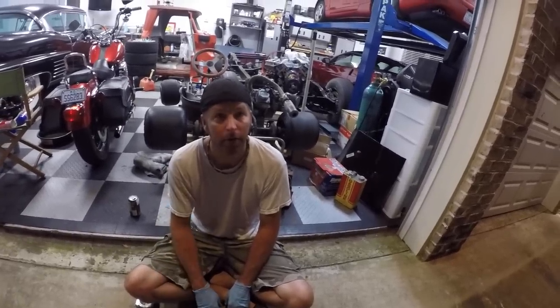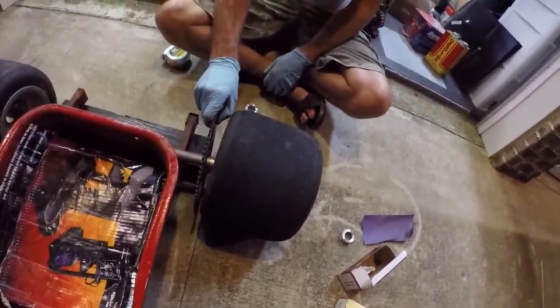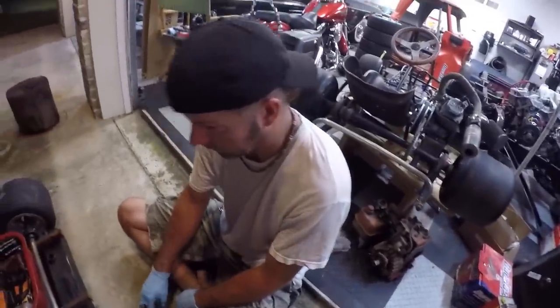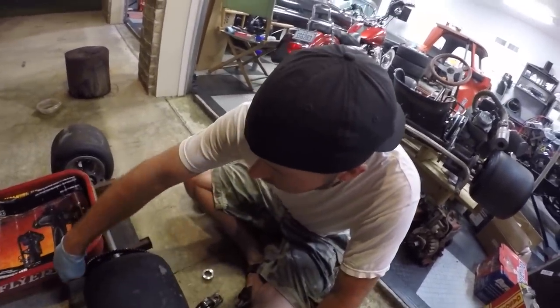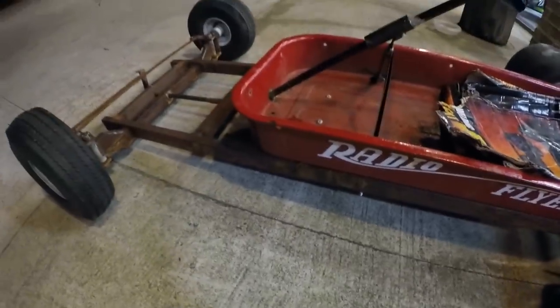Anytime we hit a bump, it's going to dig into the chain and tear our butts off. I have smaller sprockets laying around. I was hoping to put some kids on it at first, so I'm going to put a guard over that — we're going to need some kind of guard on that, or else we're going to have some angry parents. Plus, I'm going to mount some wheels so that instead of the chain going this way, it's actually going to go down to a wheel here and then go along the frame. I think having a wheel here to keep the chain nice and low is going to clean up the look of it too.